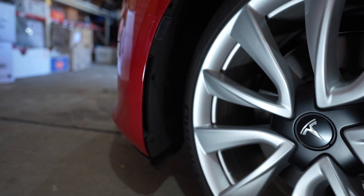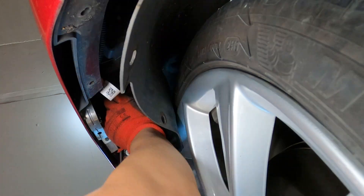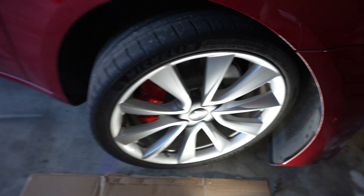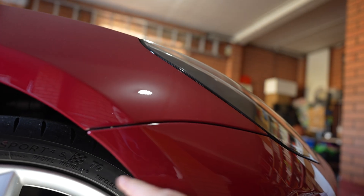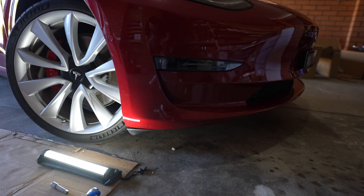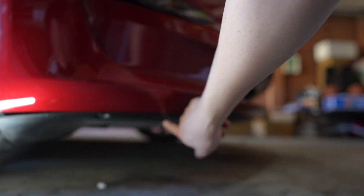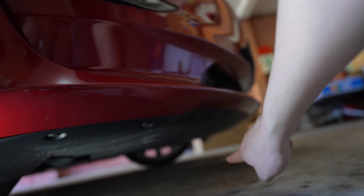We do the same thing on this end. I moved the wheel inside so I can access the inside here. Same three plastic clips that hold the fender lining, the three bolts which connect the bumper to the metal part, and then the last nut for the bolt holding down the bottom piece. Next we have to remove all the clips that hold this bottom piece to the bumper — the clips are underneath here.